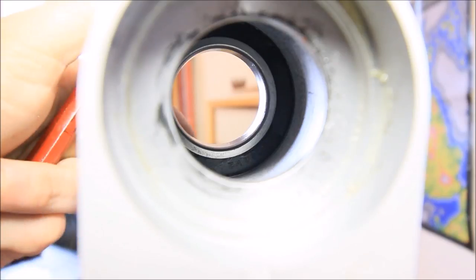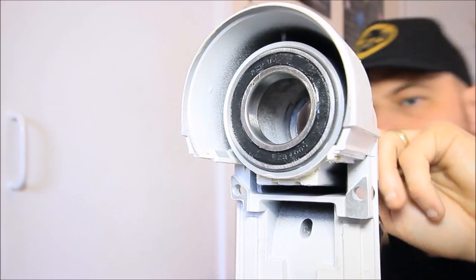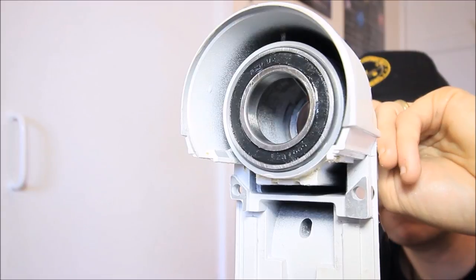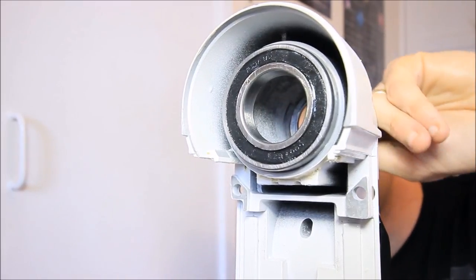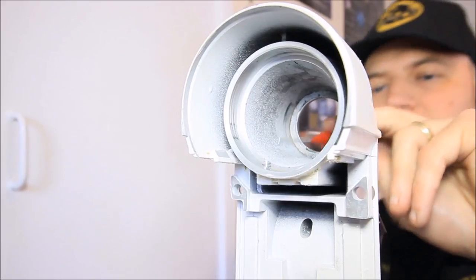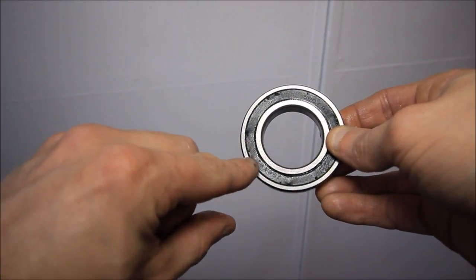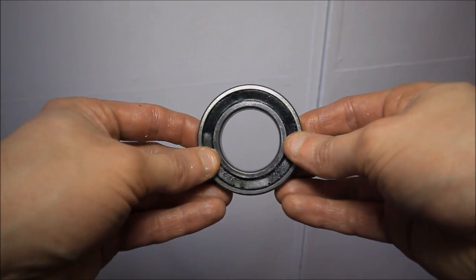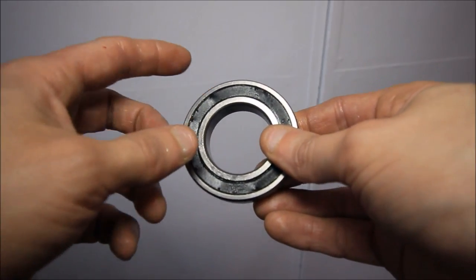This is the most I can get with the camera angle. As you take a closer look and focus in, that's where you need to hit it — right in that fore corner. It's very hard to see but tap it out bit by bit and the bearing should come out very easily. Gently, bit by bit, and it will come out. The more it comes out, the easier it is to extract. There it is — removed. As you can see, removing the old bearing, I can only just get to it and I've damaged the outer seal, so remember to get the replacement seal when you remove this. If you're doing the re-grease or stripping down anyway, it's best to get a new replacement part.